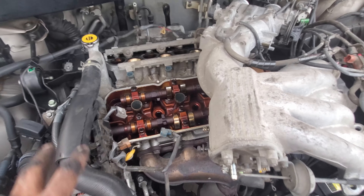I'll be showing how to do the front one just because it's a lot easier, but it would be the same thing for the rear except for the difference being the intake removal. I am going to be replacing this gasket right there — it came with the kit. So here we are doing the front one. The kit came with these new spark plug tube seals — and these are the old ones right here. I left one more in to show you guys how you do it.